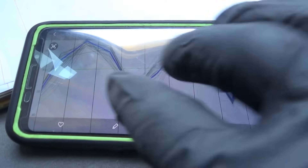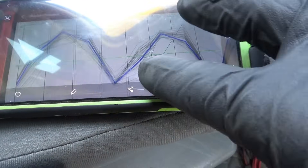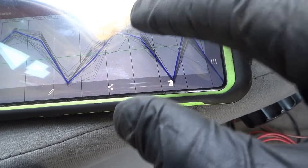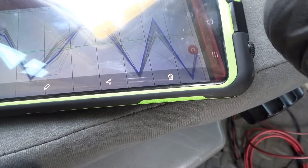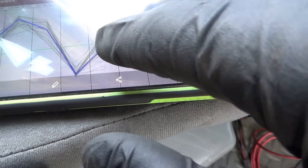This is the power of the pressure transducer - if you don't have one and you have a scope, you're missing out. This is very interesting. Which cylinders actually have good compression? Looking at our saved screenshot: number 1, 6, and 5 look okay. Number 2 is questionable. Number 7 looks strong. Numbers 3 and 4 look okay. So we're worried about 8, 9, 10, and 2.